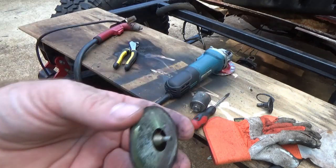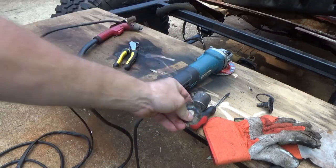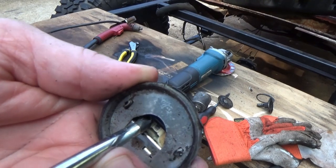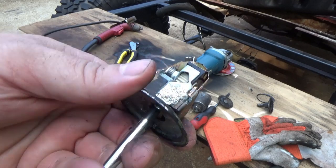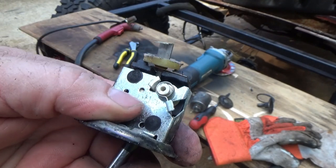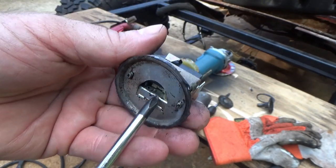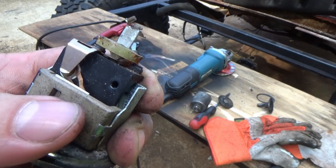What I've discovered is that this plate right here — as the oil pressure increases it's pushing up on this pan right here. Then as it pushes on that pan, it pushes on this little contact up inside here, which is actually kind of like a little rocker arm. When you push that little rocker arm with a screwdriver you see it moves just a little bit. Watch right there — those little gears are turning, and you've got the spring-loaded arm over here which pushes it back into its home position. Over here we have a contact and a little swinging electronic contact down inside there. You see how it swings upward like that.